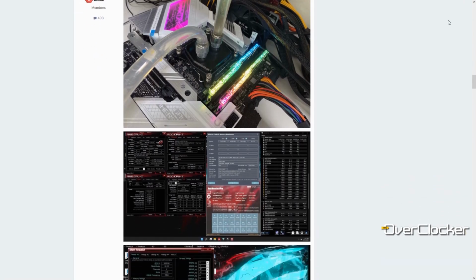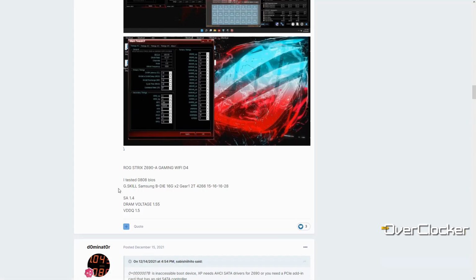When it comes to 12th gen, something more interesting happens, because you are now presented with a system that can do Gear 1, maybe up to 4133, at least the CPU that I have. And I know some CPUs that can do 4266 or even 4300 in Gear 1. If you're able to do that and put together the timings, maybe CL18 and so forth, you're generally going to get the best performance regardless of what other higher frequency you could do with Gear 2 mode,